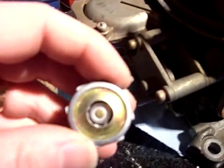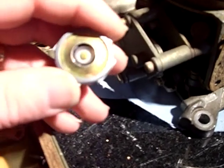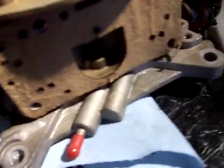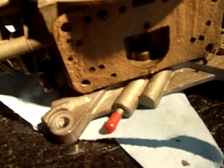But it's the wrong size, so I'm going to replace it anyway. It's the wrong one for this engine. I took my vacuum readings in drive, so it's way too small. It's opening way too early and dumping raw fuel into the engine and causing a rich condition.